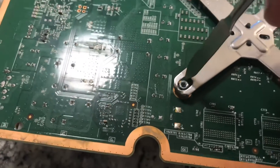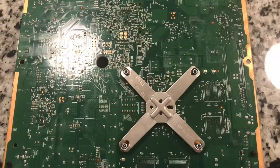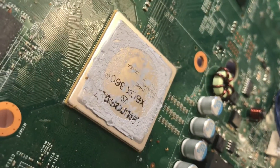To remove the heat sink you have to get a screwdriver in here and pry away from the center, and what that's going to do is release a clip down in there. You have to do that to all four - from what I understand it's a little tricky, you might have to go around a few times easing it. They're all disconnected - this just comes out. The cord from the fan plugs in right there - that white port with the yellow, blue and red cords goes into the fan. There's the heat sink, the cord I was talking about, and thermal paste which will gladly be replaced.